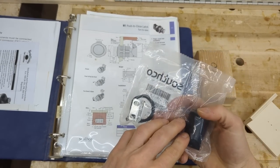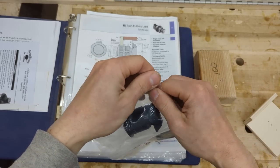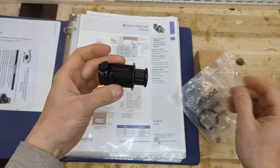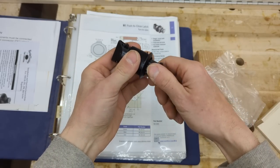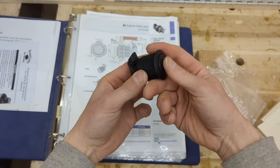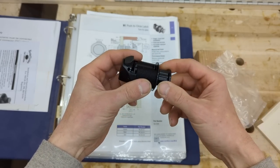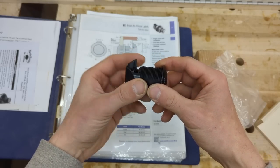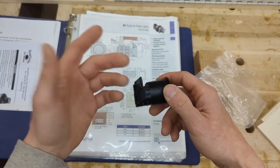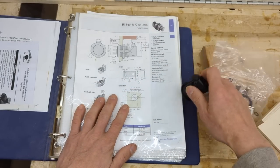I'm a big fan of these Southco M1-2A latches. I wish they had a stainless version sometimes, but I do like this black finish — the chrome is pretty pukey. The way these work is you just twist them in either direction and they open, and then they slam to close. You can lock them out by pressing this. The cool feature is that even when this is recessed, it still goes up and down. There are a couple latches on the market where once you lock it out, it doesn't move up and down — so if you accidentally lock your drawer when it's open and go to slam it closed, it can tear out the latch mechanism. So I really like these latches.